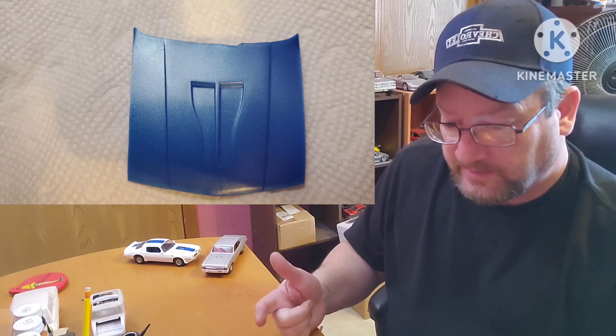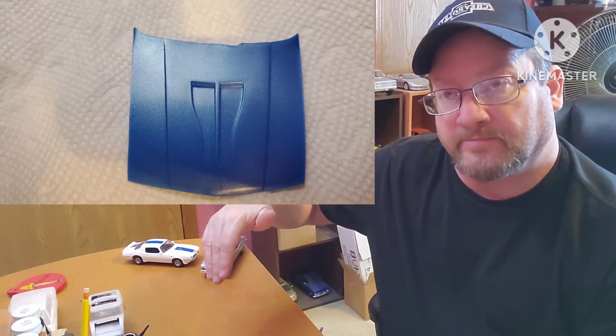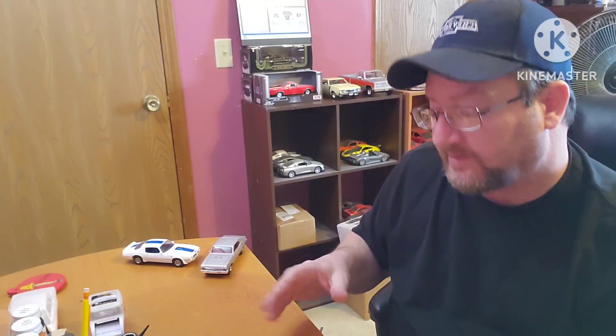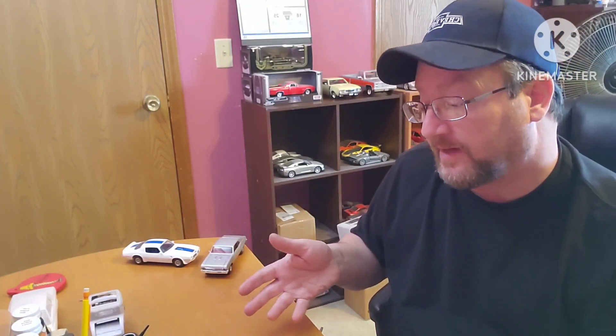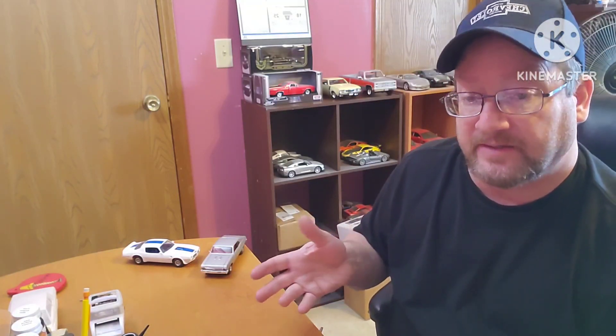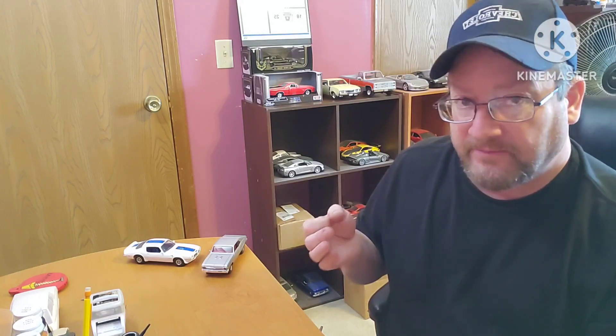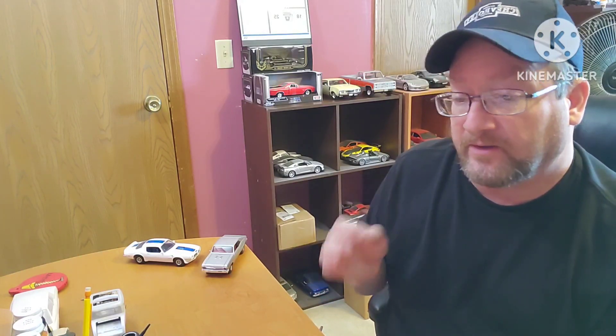So this year, the Camaro, we had chassis warpage. We had an issue with the hood where there was not enough material at the back edge, at the base of the windshield. We corrected the chassis — had to cut the chassis, had to cut the firewall — different things to get the engine and that Tremec transmission to fit in it. But it all worked out. Got the hood to look halfway decent, and then in the 11th hour last night, the glass does not fit the car.